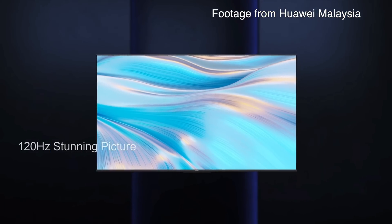First of all, there's a 120Hz display. 120Hz for a TV screen is actually kind of important because most content we consume right now shoots in either 30 frames per second or 24 frames per second — TV shows virtually shoot in 30fps, while Hollywood movies shoot in 24fps. When you're watching on a 60Hz screen, they use motion smoothing interpolation to change 30fps or 24fps up to 60. But 60 is not a multiple of 24, so upscaling 24fps to a 60Hz screen looks weird. 120Hz is a multiple of both 30 and 24, so upscaling from 24fps to 120Hz looks more natural.